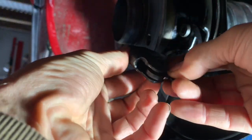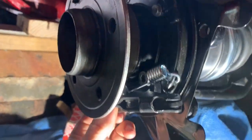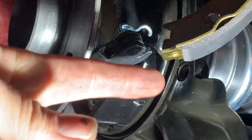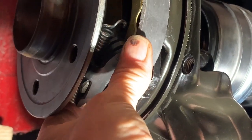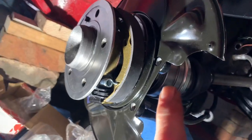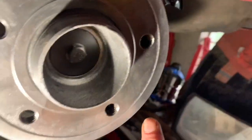Put a tiny little bit of grease in there to lubricate it. Thread this spring in first while everything is still loose. Once you've threaded the spring through, the next thing to do is attach the bottom of the shoe into the slot and then use something like a screwdriver to hook that spring into the hole — it is very fiddly. What we're trying to get to is that arrangement there, with that end of the spring hooked in. The top spring is now completely connected and the bottom spring is just connected on this side.